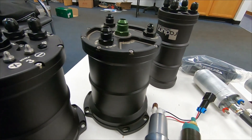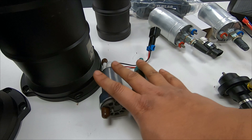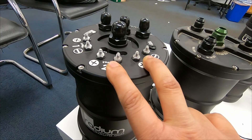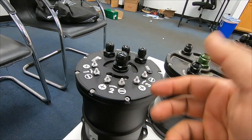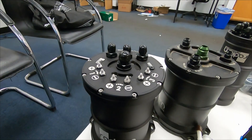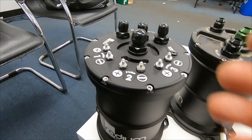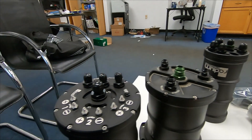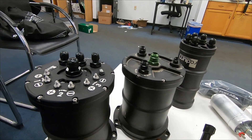Now the different types of surge tanks you can run — again, internal. So you will always have a pickup inside the stock tank, and it'll feed two more pumps inside this surge tank that are built in here, literally sitting in like that. Through these fittings it's feeding the rail, the tank, and the stock tank. This one has three internal pumps; all three will feed the rail. This is actually going in the Eclipse that's aiming for over 1000 horsepower. This is an internally pumped surge tank, and it would have these kinds of pumps inside, feeding the rail and also feeding the regular tank.